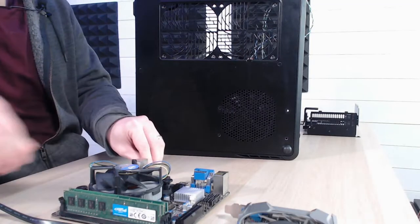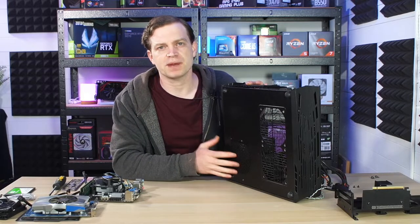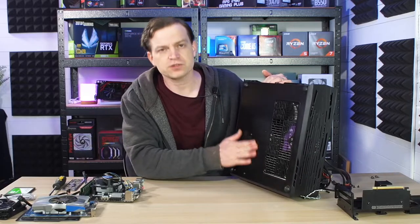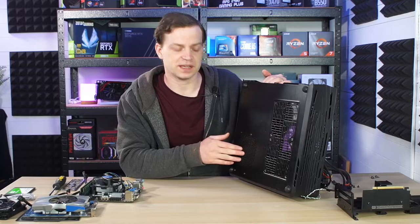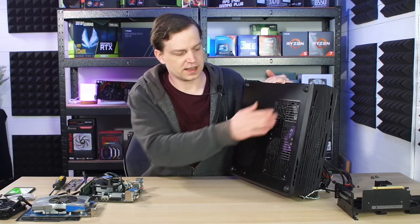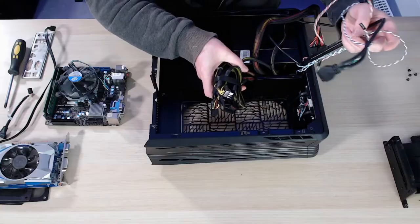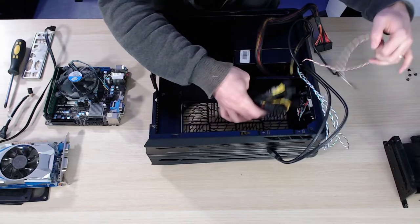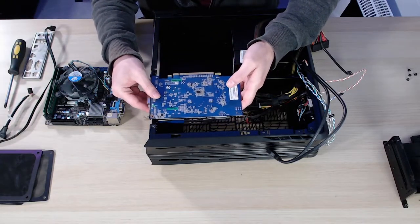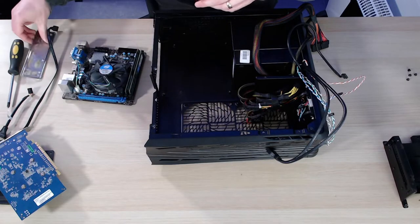Once installed, all we need to do is drop the power supply back down into the socket — this is where it's going to get tight due to cabling — slide it back into place, and then we need to line up those screws on the bottom again to mount that tray back in. The power supply in this system is probably the most annoying thing purely because of those cables and the way that you actually mount that tray. There's also no dust filtering at all on the PSU cooler — they do come with these little magnetic trays but there's no actual mount for this one, so the power supply will get a little bit dusty.